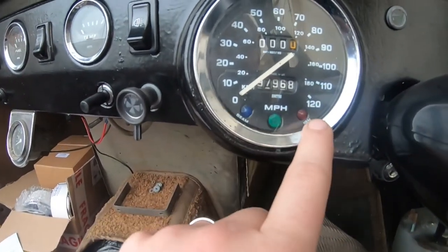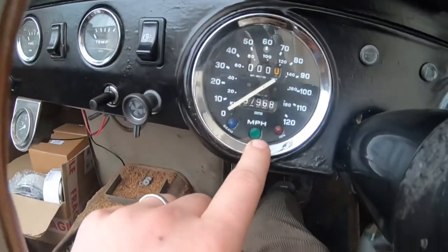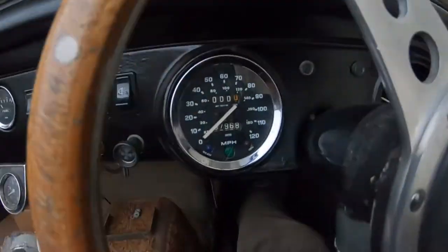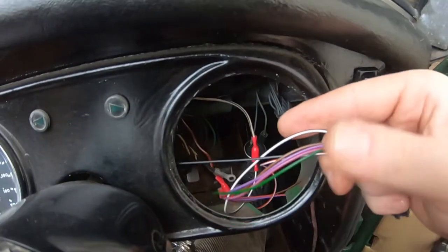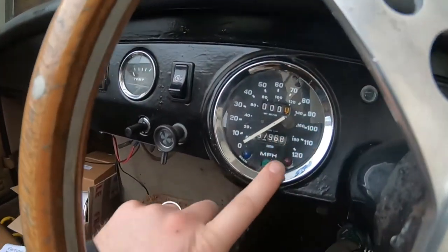Because I'm replacing the speedometer, I will be losing my main beam, oil pressure light, and ignition light. The tachometer does have options for indicators and main beam, so my plan is to replace the oil and ignition up where my indicators currently are, and move the indicators and the main beam onto the tachometer. I can see the main beam warning light, pull the bulb out, test it — yes, that's the one. The ground for the main beam warning light is connected. The wiring diagram says warning lights 'if fitted' and mine doesn't have it fitted, but the wires are in the loom. This speedo is going anyway so I'm going to have to do something with those warning lights — I'm not too bothered about that.